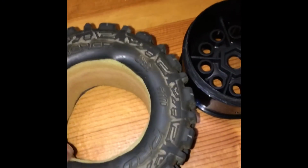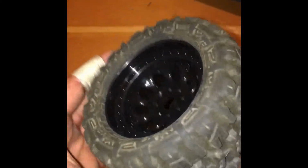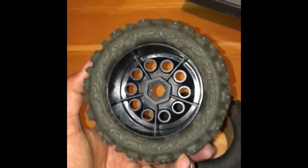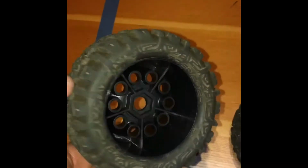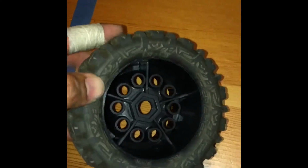Alright, now to stretch the 2.8 Trenchers over the 3.2 Revolvers. I already did one. I didn't glue it yet, but mopped up. Basically how she's gonna roll. Nice low-pro sidewalls. Same width. They should get less meat that hangs over the sides compared to the Desperados, so guaranteed better handling with stiffer sidewalls.